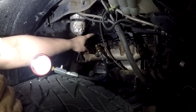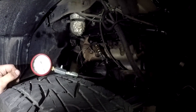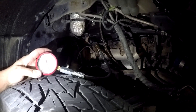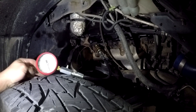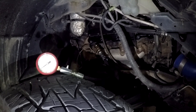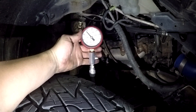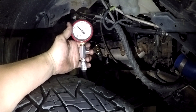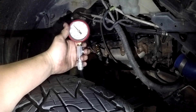I've threaded in the adapter and put the attachments on for my specific gauge. I'm going to crank it over and see what this cylinder reads. I've already diagnosed this one — it's the cylinder that is low on compression — so I'm expecting to see around 280. That cylinder came in at about 280 psi, which is below average. I'm going to go through and do all the others to confirm this one is not contributing as much and that's why I'm having issues with the truck.